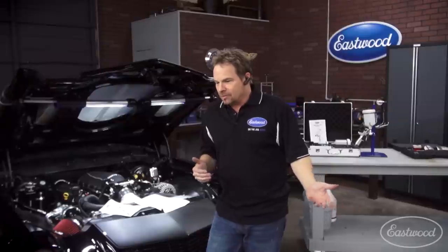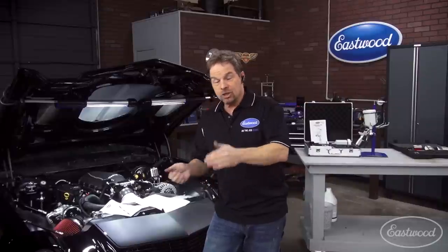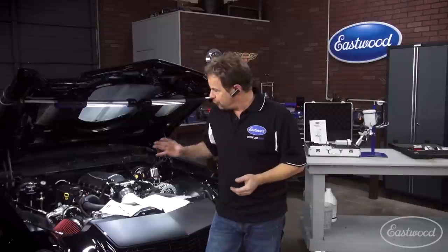So I V'd the crack out, the split out. I made sure I had a good positive fit. I actually put a piece of duct tape on the top and I went to work with my spool gun and I fixed my lower intake manifold in probably, I don't know, 45 minutes. And I can TIG weld, but I'm not like Matt Murray. I'm not a very good TIG welder. I'm a student of TIG welding. I've seen him stack dimes. He's very good. Not my forte. MIG welding is what I typically reach for.